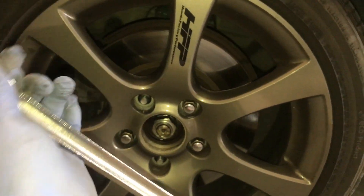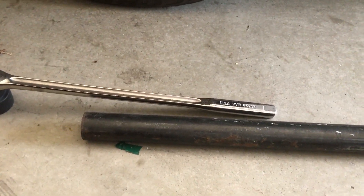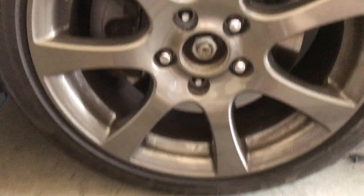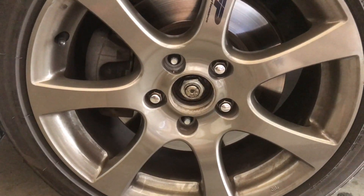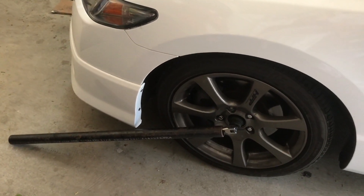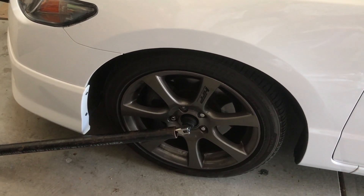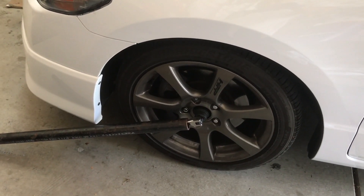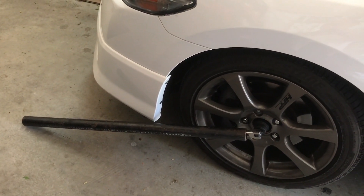What you're going to need is a breaker bar. This is a pipe that you connect to your breaker bar because you're going to need leverage. This axle nut is going to be pretty tight. If you don't have a power tool, you'll need a breaker bar with a long pipe. You can see the 36 millimeter socket on the axle nut, and here is the long pipe I used to loosen it.